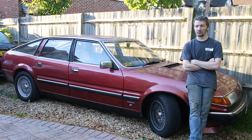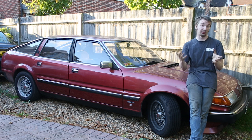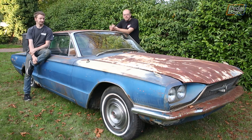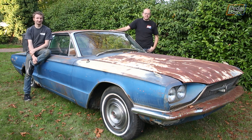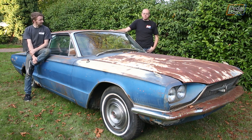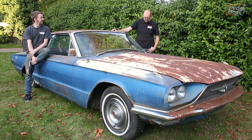I don't think the head gasket has ever been changed, and the compression seemed a bit low when I was checking the plugs, so I've got a new cylinder head gasket and a bunch of other gaskets and new plugs — all that sort of fun stuff. You'd think that with all of those different cars, all of them needing a bit of work, getting another one would be a stupid idea — and you'd be right. Nevertheless, this is a 1966 Ford Thunderbird that I bought on eBay sight unseen and had drop-shipped to the house, which is probably a stupid idea — but it is a stupid idea that's turned out better than I could have expected. It's a 390 big block, three-speed automatic.